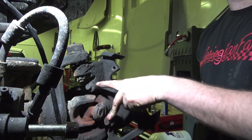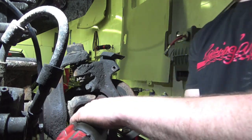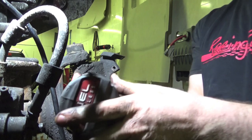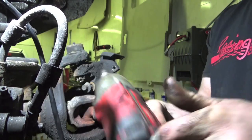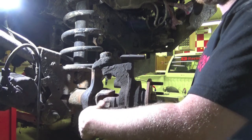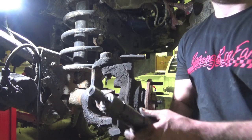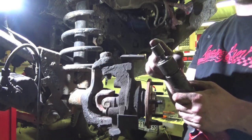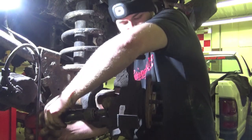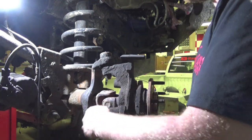On the back of the knuckle, we have three 9/16 or 14 mil 12 point bolts that we gotta remove to get the hub off. So now that we got all three of our wheel hub bolts off, we're gonna thread one in and we're gonna use a nifty tool to get this hub out that attaches to our air hammer. So we're gonna start this guy with a few threads, get them in there. And then we got this right here, which is actually designed to go right over the head of this. I'll put the link in the description below for your air hammer to go right there. And just like that, pops the hub right out. Super quick, super easy. That tool kicks butt.